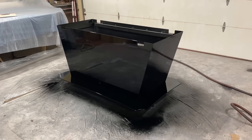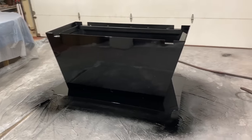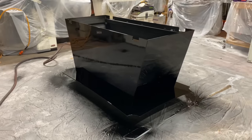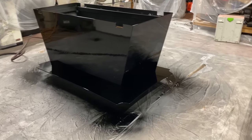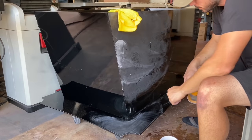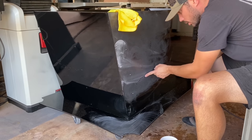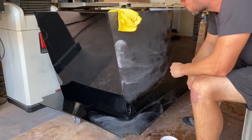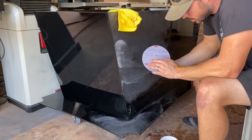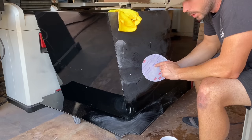We are finished. It's super late, been about 30 minutes or so — pretty much flashed off. It's going to be real nice. As you can see, a lot of runs here. It was super late when I sprayed this, just in the clear, so we're just going to knock it down, get everything flat, get all the orange peel out. Starting with 1,000 grit, and then we're going to work up to 3M's Trizac 8,000 grit pads. Then we're going to buff it out.